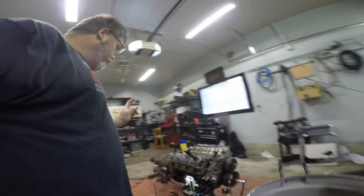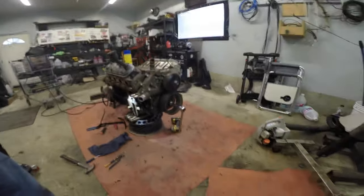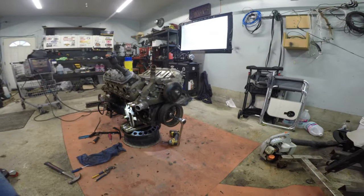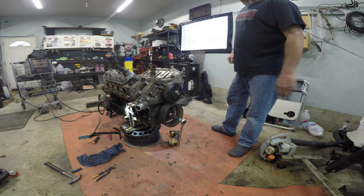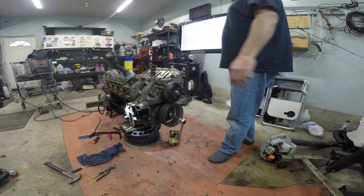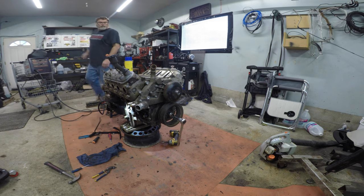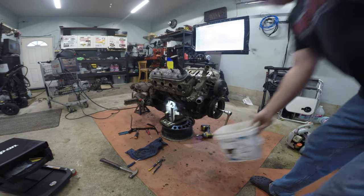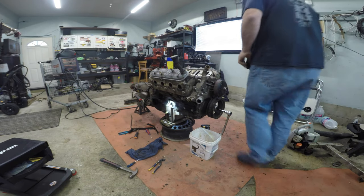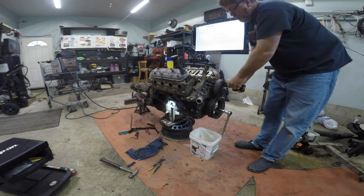But we've got the bolts out of the heads. We've got the dipstick into the bottom of the oil pan, which is good. We're going to yank this water pump off because I'm going to do gaskets and the water pump. I've got a new water pump but I don't think I'm going to use it. Let's get this off the way - we're going to have a little bit of coolant here, of course. So I'll slap the bucket under there and see what happens. We're going to go with a 10mm on this - sure is.